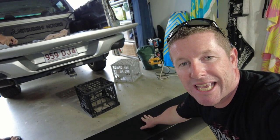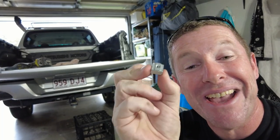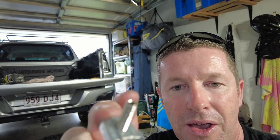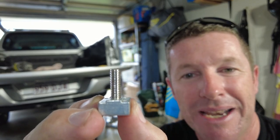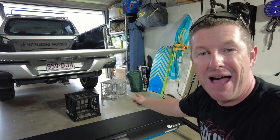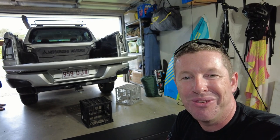Put the cover plate onto the canister and fix it via three mounting screws on either side. Then you have six square nuts — three on either side — that go into the bottom track of your side rails. Fit the stud onto each square nut first, then slide them in so the grub screw faces up and the stud comes out of the rebated section so it can slide through the track. Now we're ready to lift the roll top up onto the tray, do a test fit, make sure everything's good, and then fix it down.